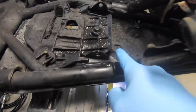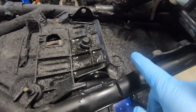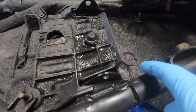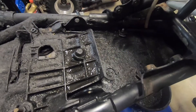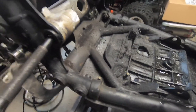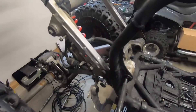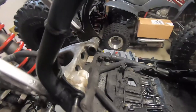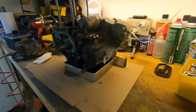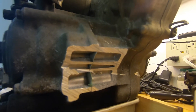What I'm gonna do now — I won't record it — but I'm going to pull the skid plate off. There's a vent for the lower case of the engine, and it looks like maybe oil comes out of it occasionally. I'm gonna put a hole in the bottom skid plate with a hole saw so if it does leak oil it can go on the ground rather than building up in there. Then I'm going to clean up the whole frame, take the brakes off the rear swingarm, take the tires off, pull the swingarm out, and get ready to rebuild the pivot point. The engine's on the bench — let's take a look at where I sawed it off.